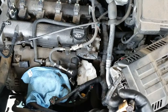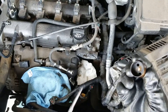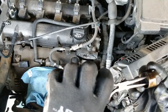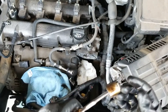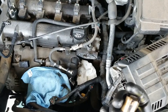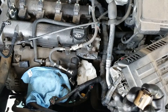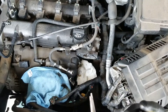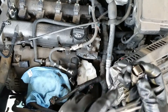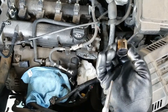This is what it looks like. You can see it has two holes. What I did was I just stuck the little nose in there, let it grab it, and just kind of wiggled it out. It has a groove on it so we will not make a mistake putting it back. This groove right here — there's a slide in there — and this part, like a bearing, rides the camshaft lobe.